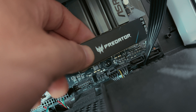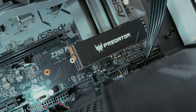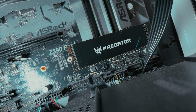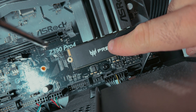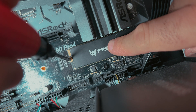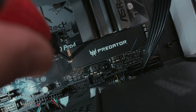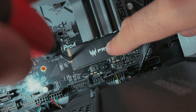Just make sure it's really in — don't push too hard, just kind of leave it. Let it be in place. It's going to sit on its own at an angle; that's how you know you've inserted it correctly. Now that the SSD is in place, grab that little screw it came with, gently push it down, and go ahead and screw it on top of the SSD. It'll smoothly hold it in place. Just make sure it's not too tight but not too loose — you want it flat against the motherboard.